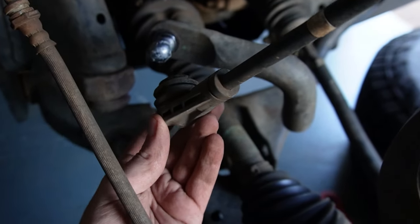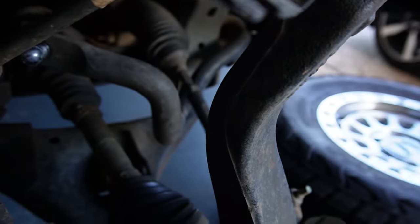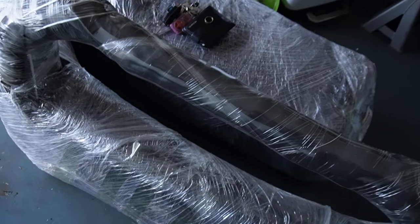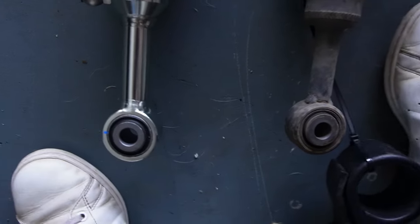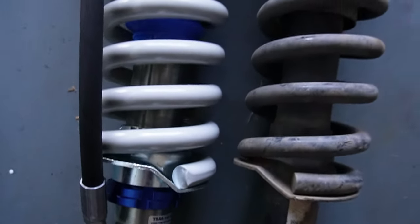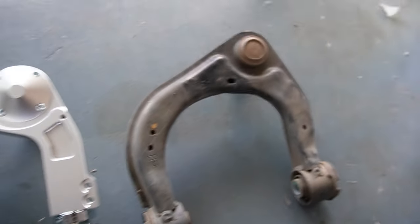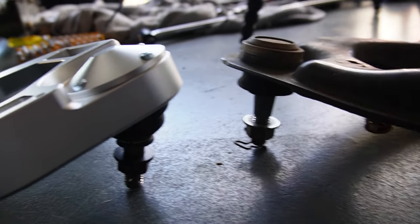I think I have no idea. Maybe I can just push it back on. It's not broken or anything, it's just off where it usually sits. So I made sure I ordered the spring rate that takes 100 kilos because we've got the bar and a winch going on the front. These stock ones have suffered with that bull bar on it for long enough. It's only a little bit longer — this is meant to be set at three inch, so I might just get it in there and see what happens. We have old versus new. Looks a little bit sturdier when you look at them side by side.